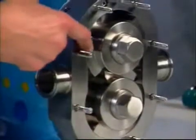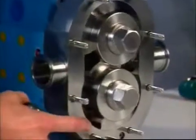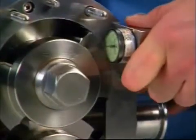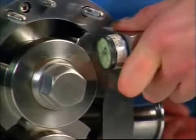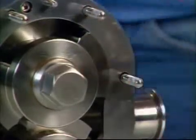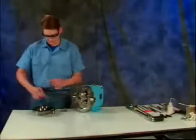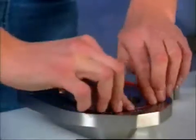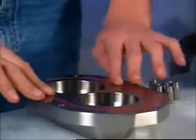The rotor wings must be below the body face and can be felt with the fingers or thumb. You can also use a dial indicator or a straight edge and shims to compare front face clearances with table values. Install a new o-ring in the cover groove — it usually helps to stretch the o-ring if it doesn't fit freely into the groove.